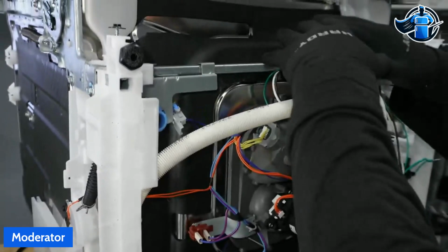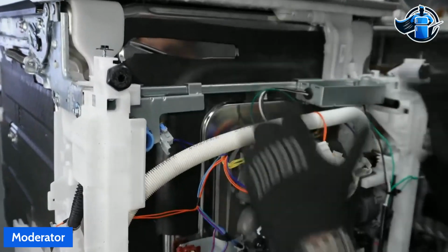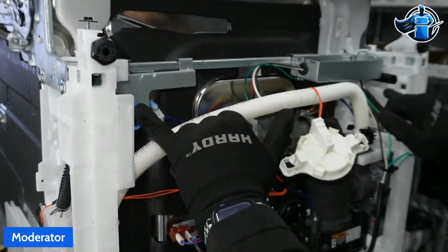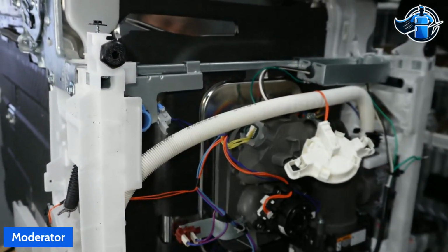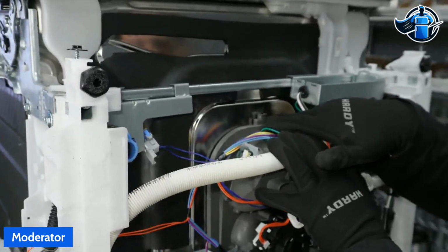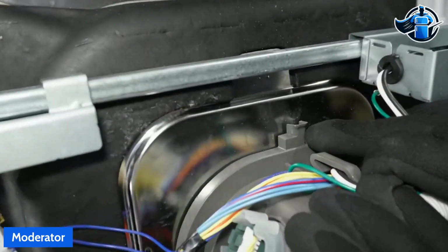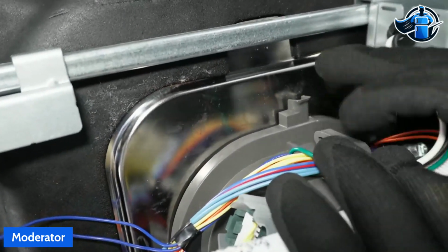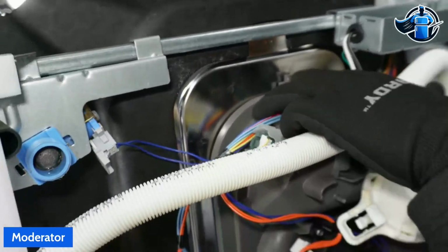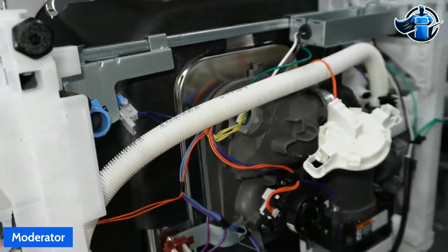Second is going to be anything to do with our spray arms or any surging inside the tub. And that's where clear doors can come in handy. We're going to get water down these tubes. And third is going to be this little nozzle area here, this little funnel area of the sump assembly itself. That is going to be our third potential. This is the rarest one, hardest one to find.